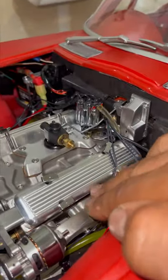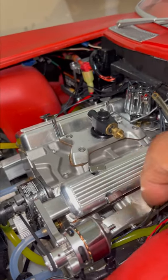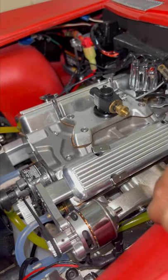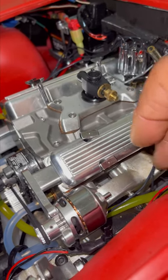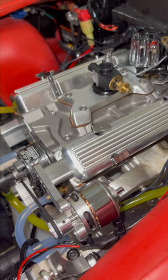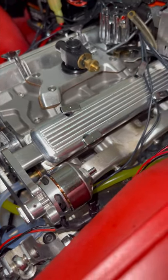And what I did also was the exact same modifications on this engine that I did for the runner. I replaced the cork here for the gaskets and used a metal flange and some copper gasket maker, and took the old glow plug connectors off and used some plug locks so that I wouldn't have any concerns about grounding out. And so that I did that, and then I richened this up.